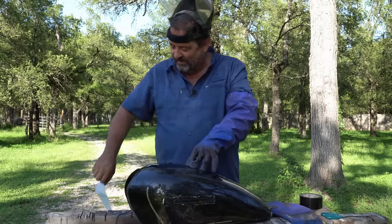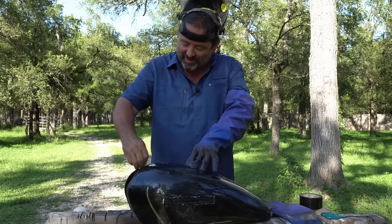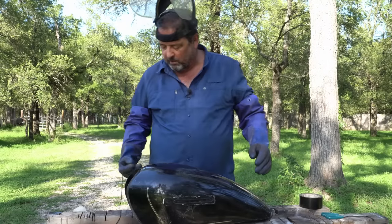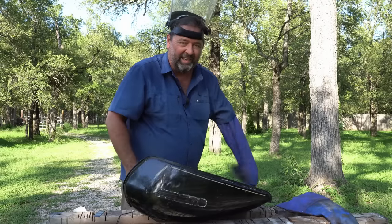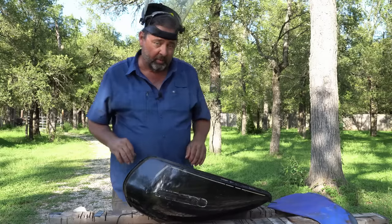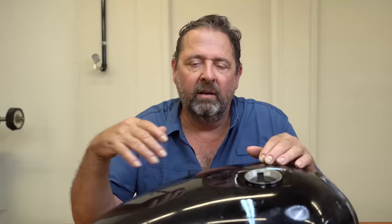Clean, clean, clean. Smoking too. Yeah, it's hard to beat muriatic acid. Right after the muriatic acid I'm going to wash it down. Looking at the inside of the tank - I'll show you the seam where the top and the bottom part of the tank is put together. You can see here where it's all rusty and nasty before I did the treatment to it. And now after the vinegar and the muriatic acid and washing it down, it's the difference - these are two totally different things. It is a beautiful gray, which is exactly what you want. No corrosion, no impurities, nothing - just raw steel. And that's what I'm able to achieve by just using vinegar and a little bit of hydrochloric acid.